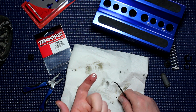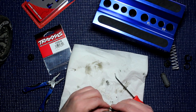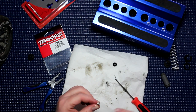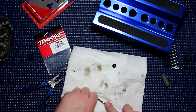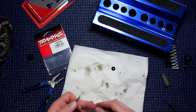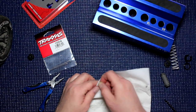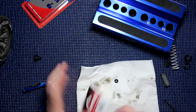Now basically remove the piston and clean it at the same time. You do have another C-clip on the bottom — we're going to do the same thing again and pop that one out. Rub both sides just to remove the excess oil. Now this shaft here, we can discard it if you want to. Put it aside and grab one of our newer ones — a lot straighter.